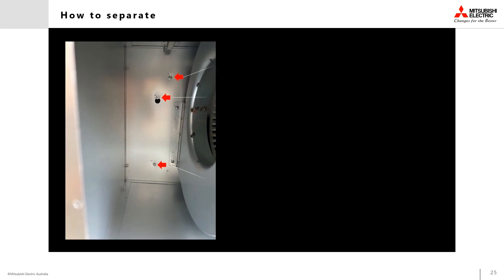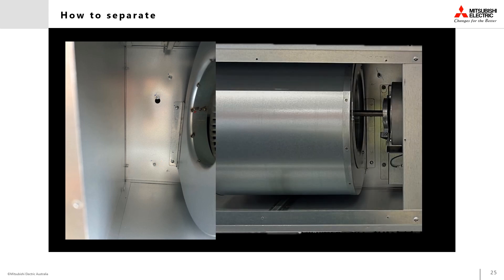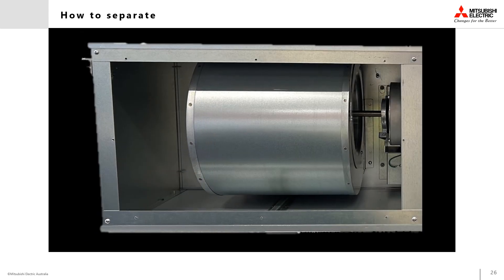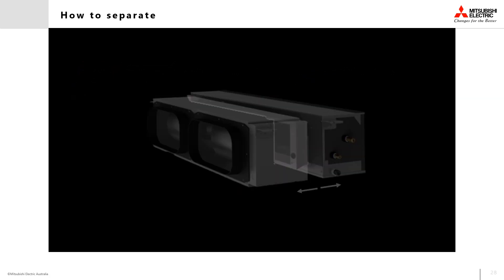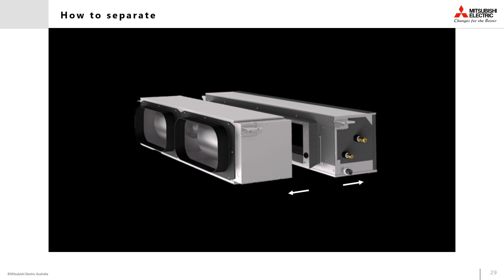Mirrored on the left hand side, two screws at the top and the bottom secure the unit together, with the guide screw in the middle that needs to be loosened or removed from the snowman-shaped cutout for separation. Once these steps have been completed, the two sections can be separated.